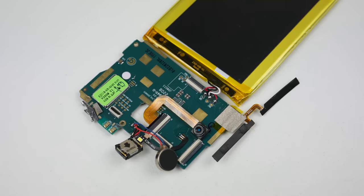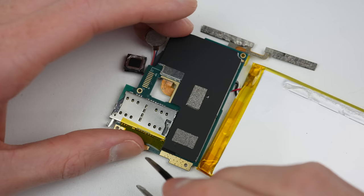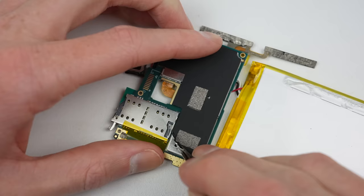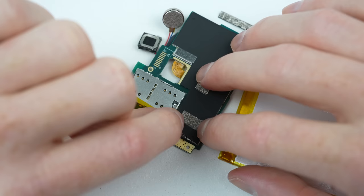On the board is something interesting — a label that reads '1GB plus 8'. To me that sounds like the RAM and storage configuration: 1GB of RAM and 8GB of storage. On the flip side of the board, I wanted to get a look at the processor, but after peeling back the protective tape, I found it's all been covered with metal shielding. While I could desolder it, I'd probably damage the phone, so I can't confirm exactly what type of processor it is — but it's definitely not as advertised.